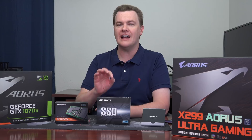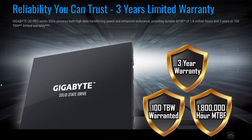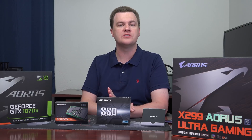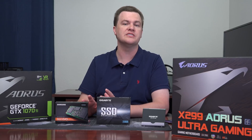Spoiler alert: it's not as fast. I'll show you benchmarks, but it's close and it costs less, which is really nice. It does come with a three-year warranty and either a 100-terabyte or 200-terabyte total drive write-life endurance, depending on whether you get the 256 or 512 gig size. Those are plenty — if you use those up in three years, you needed serious professional drives. Those are huge write endurances that normal users will never, ever hit.